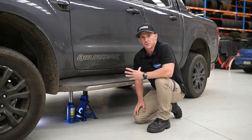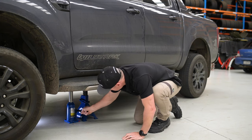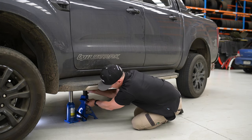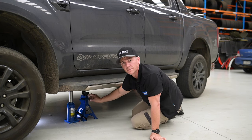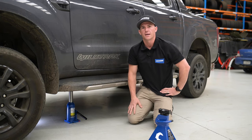At this point you've done the work that needed to be done under the car. Now you need to take the jack stand back out, so we raise the jack back up and take the weight off the jack stand. Grab the saddle of the jack stand, lift it up, and at the same time lift the handle. Careful not to pinch yourself as it's coming down. Slide it out. We can then release the jack and away we go.